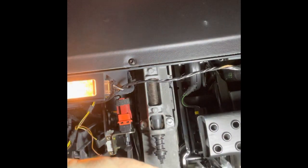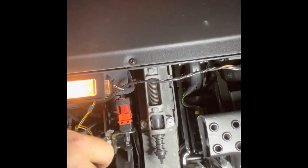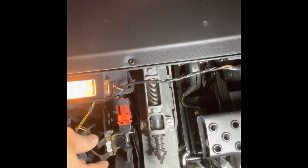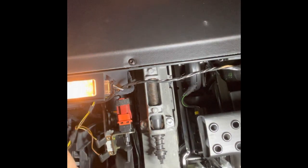This white switch right here is your clutch safety switch for starting the car. It's got a little bit of play — I've tightened it up several times already, and every now and then I get a depressed clutch switch warning even when I'm pushing it through the floor.